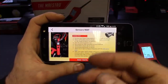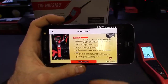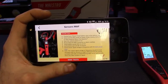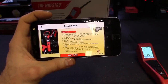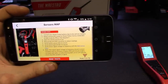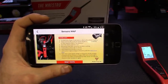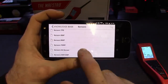Here's a picture of the Power Probe 4 — it shows you right here exactly what to do: connect your Power Probe battery clips to the vehicle's battery, select normal DC mode for Power Probe 3 series, 3S, Power Probe 4, and the Maestro, start the vehicle, let it run, back-probe the mass airflow sensor connection to obtain readings. Having it right here at your fingertips, showing you how to use the tool, so you're not second-guessing yourself or thinking you're misdiagnosing or not using the tool at its full potential. There's no other company that gives you information like this with their new technology — most companies just throw things your way and say kind of figure it out. I'm kind of referencing MultiProbe here — still learning how to navigate through that tool. But having all the information right here in front of you on an app you can pull up off your phone — all the information for what they have — is tremendous.